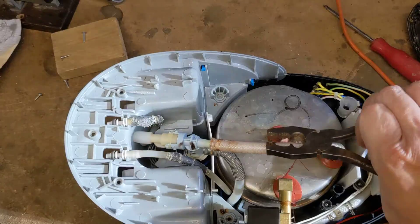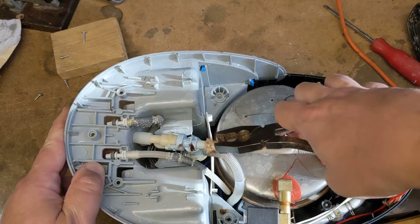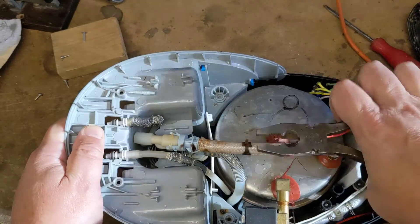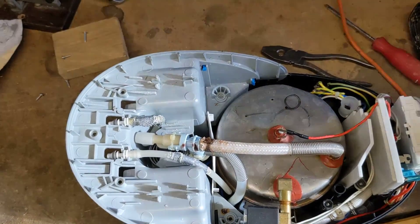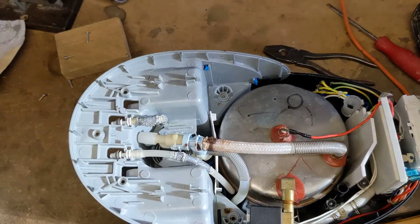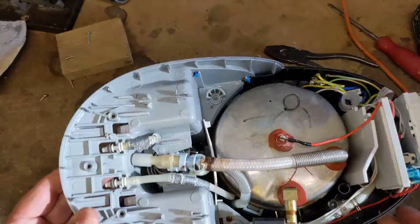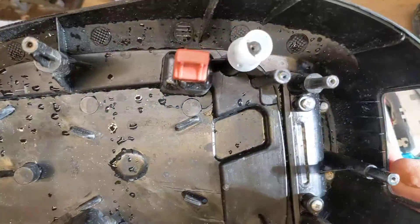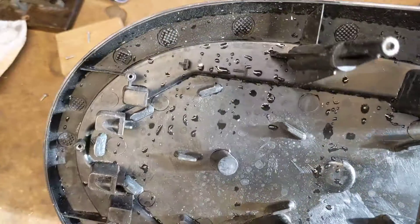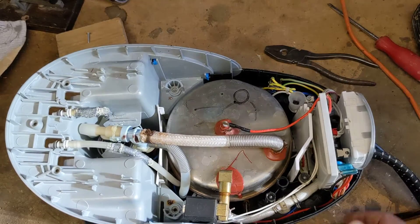Quick, simple solution: just put the tube back on the spigot and put the spring clamp back in position, and as long as the temperature in the conservatory doesn't get too hot in the future it should work okay. There was quite a bit of water collected in the bottom — when I turned it upside down, all the water ran in. So just watch out for that. Before you screw it back together, make sure you've given the electronics a good chance to dry out before you attempt to plug it in again. Thanks for watching.